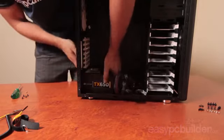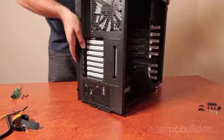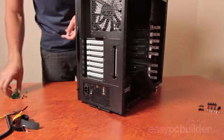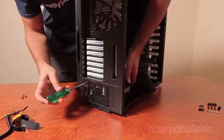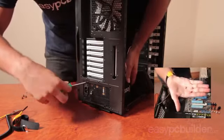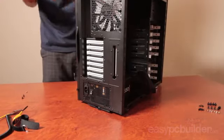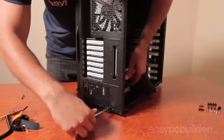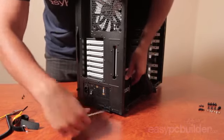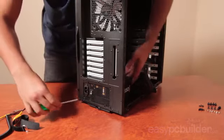These days with painted cases, your strap won't conduct to earth properly unless you find an unpainted surface to attach to. So I've attached the wrist strap to a non-painted conductive area by using a riser as a connection point to ensure good continuity to ground. When the build's finished, I'll simply remove this and put the normal mount in. But as the thread in this riser interfaces directly to the earthed PSU casing, it's the best path available with a painted case like this.